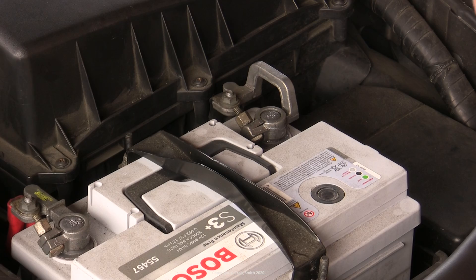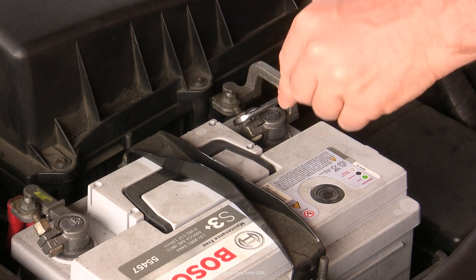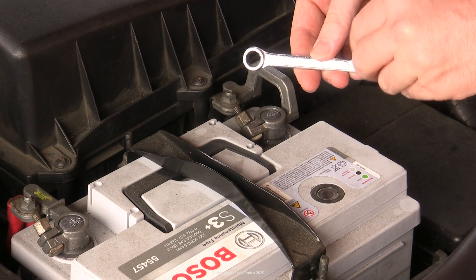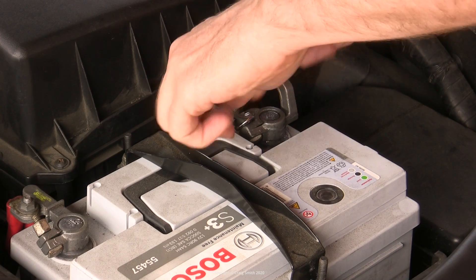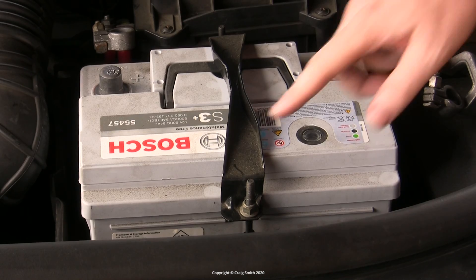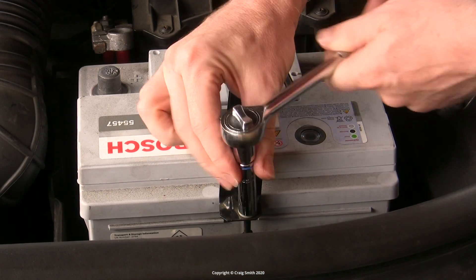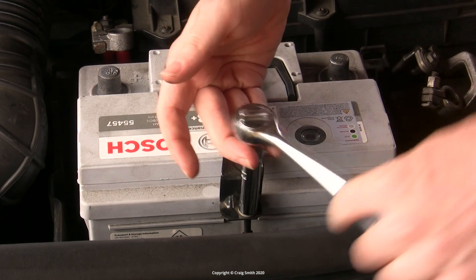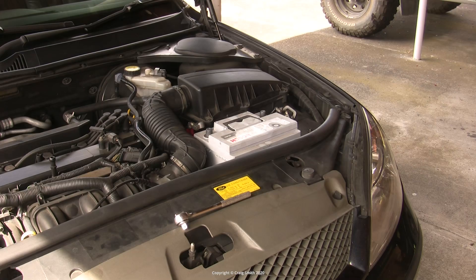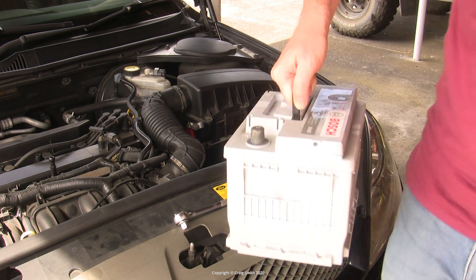I did need a new battery, so the old one had to come out. Disconnect the terminals and do the negative first — they're usually clamped on with a nut and bolt, so just undo that and pull off the terminal. Use the ring end of a spanner, not the flat end, otherwise you might round off the nut — you can also use a socket. After that there will be a retaining system holding the battery in place, like this steel bar held by threaded rods. Undo the nuts, remove one, and rotate the whole thing out of the way. With that, the battery is loose and can come out — sometimes they have built-in carry handles, which makes that convenient.